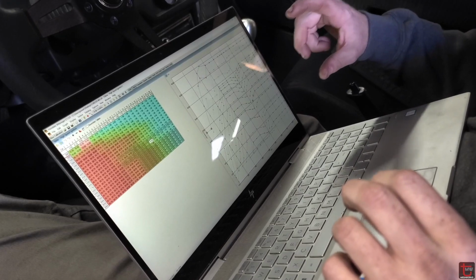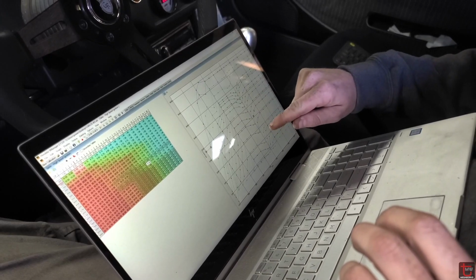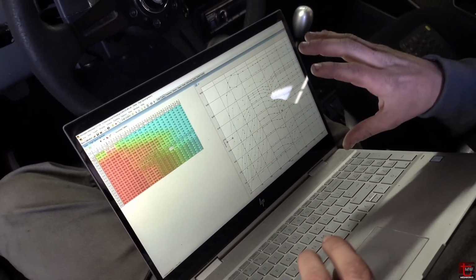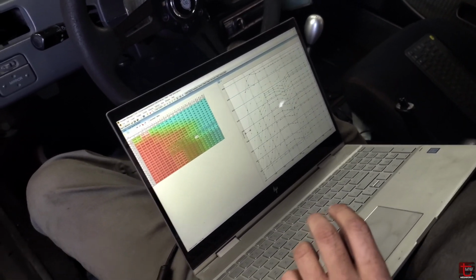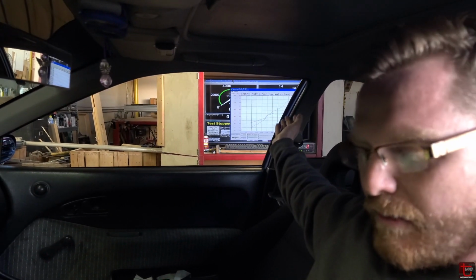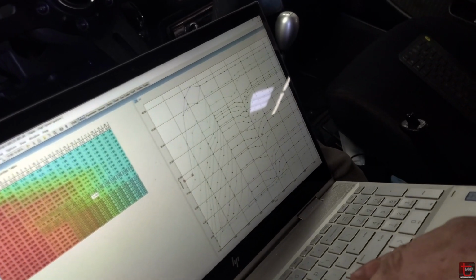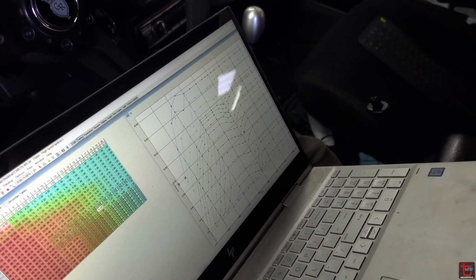Next thing I want to talk about for just a moment is where peak torque happens and where my timing dip is. What I found a moment ago was that my peak torque dip built into the map was maybe 500 RPMs off of where peak torque was actually occurring in the car. So I consulted closely with the dyno plot, which showed peak torque at about 5,500. My lowest timing was at like 5,100 here. So I just went in right now and kind of massaged the map in this area to make sure my lowest timing is happening at my peak torque.